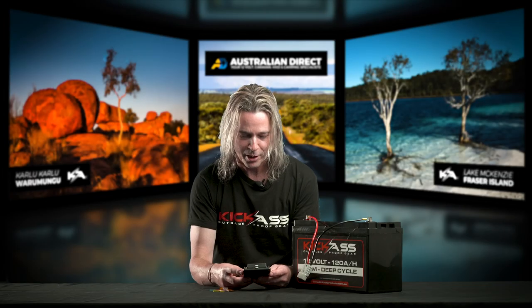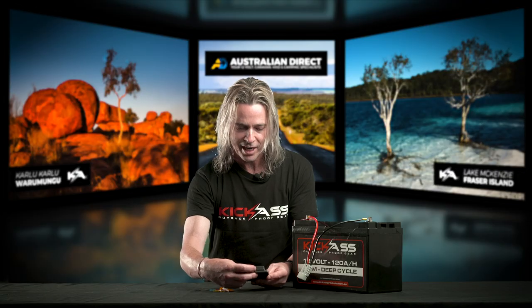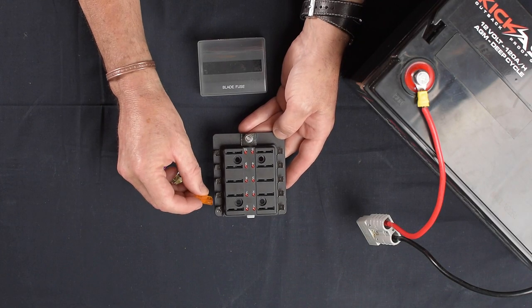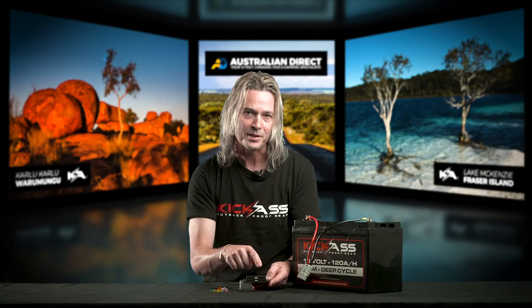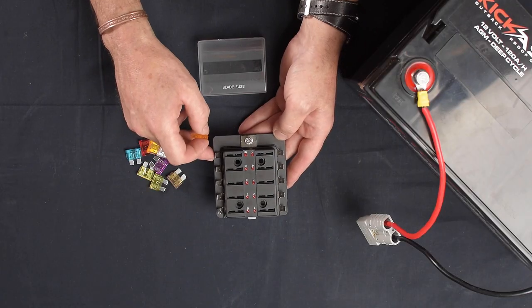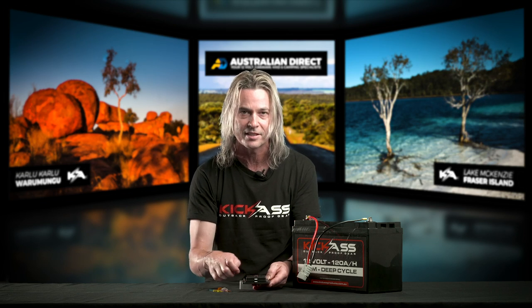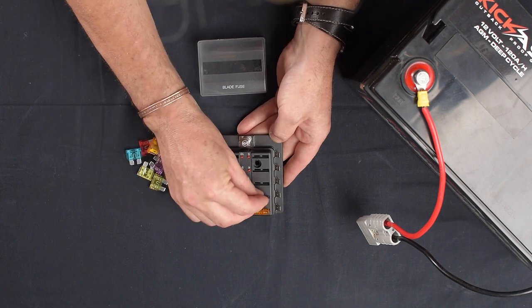Okay, so here's the fuse holder here. It has the little white locking mechanism to pull the cover on and off. It does take just your standard blade fuses. Now, the thing to remember though is that 25 amp is the maximum amount of current that'll flow through this per channel, and it has a maximum of 100 amps altogether. So you just gotta work out what items you're gonna have and where and how you're gonna set it out. But as I'll show you, it just takes the standard blade fuses, which is so easy.